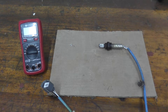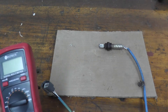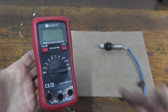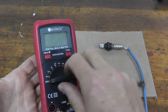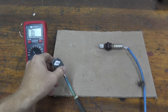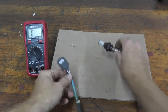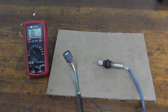Fortunately testing this sensor is very easy and quite quick. All you need is a digital multimeter — this one is $20 off Amazon. We are doing an ohms or resistance test, which is simply the omega symbol on the multimeter. A good reading for a sensor is typically between 10 to 15 ohms. The colder the temperature, the higher the number. If you don't see a reading at all, the sensor is bad.